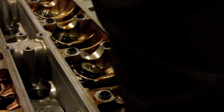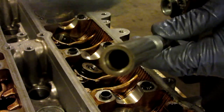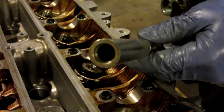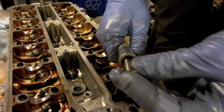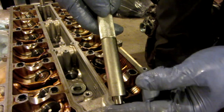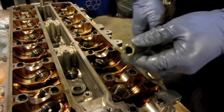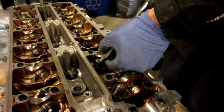So here's a little trick that I've come up with that helps most times. To get that one keeper out you just gotta use your tool and bang down on it. Now I'm going to set up just as before, but my keeper is in the right way all lined up. The key is this tool is just a hollow piece so you can push down the spring without pushing on the valve. What I have here is a metal dowel that fits exactly in the hole, and that's what we're going to use for our trick.